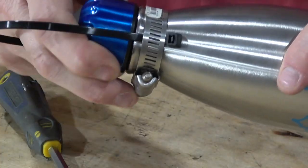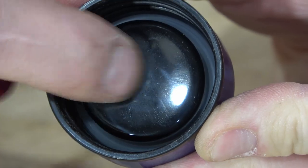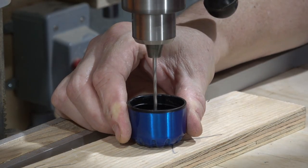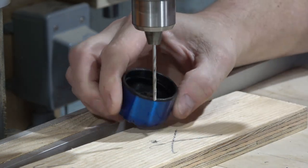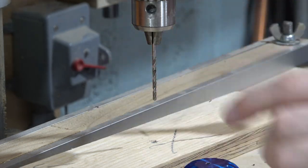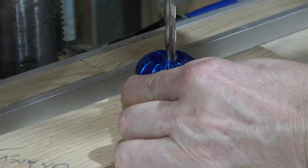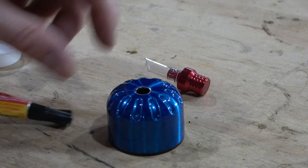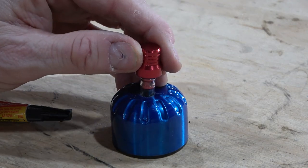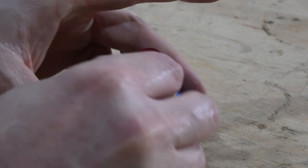I'll check that the cap fits on — and it does, really good. The cap needs some form of venting, so I'll drill a hole through it and use a piece of fuel line with a motocross vent on top. There's also an internal cap I need to drill through, so I'll use my drill press and drill from the inside out — giving me a pilot hole to the outside and a small vent hole through the plastic itself. Once done, I'll take that little piece of fuel line, use a relatively similar-size drill bit to enlarge the hole through the stainless steel from the outside in, clean out all the shavings, and seal the fuel line into the top of the blue cap with a little super glue used like caulking. I always buy my super glue in packs of five from the dollar store — it keeps it fresh and this stuff works really well.